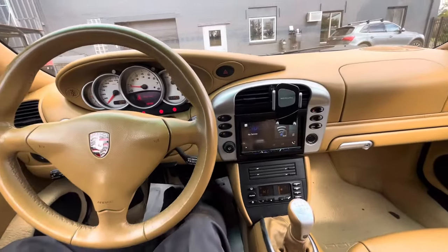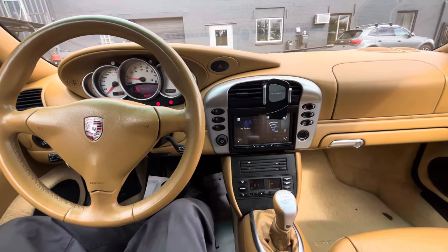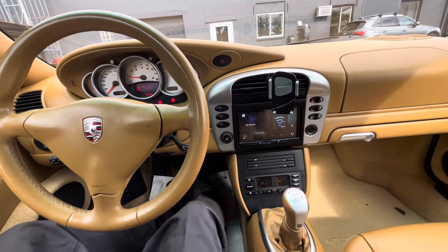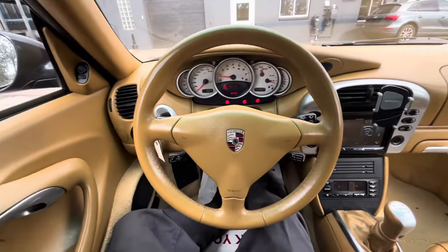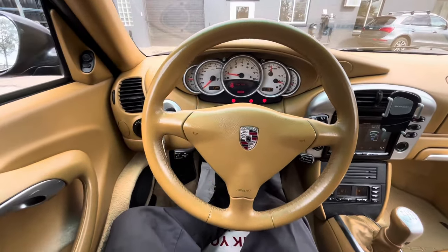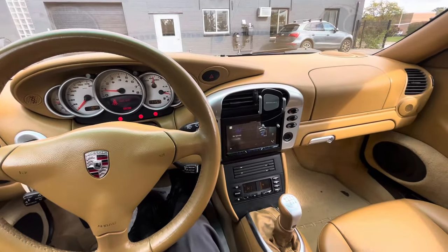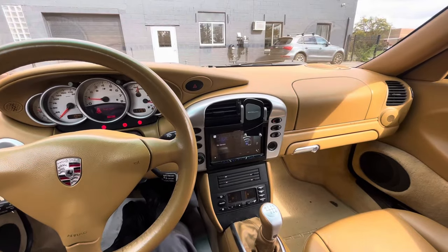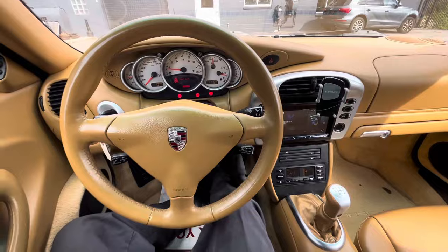The fix is not easy — you'd have to pull everything apart and replace your whole climate control assembly, or replace the doors. Sometimes the doors can be replaced individually depending on the car. So if you're seeing that, now you know what it is. You can just clean it out the best you can and deal with it, which is what most people choose to do, or if you're feeling up for a pretty big repair, pull it all apart and change out your doors. Thanks for watching.